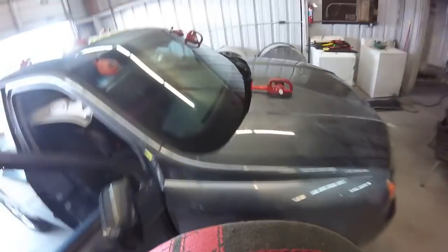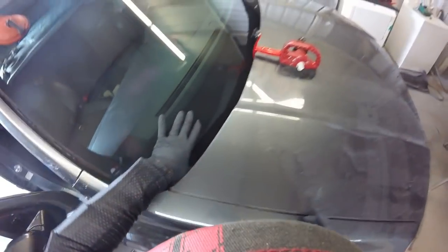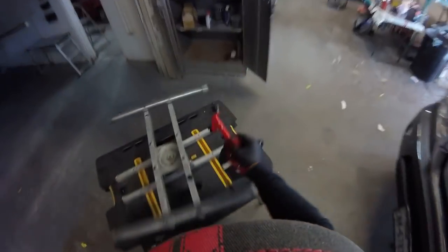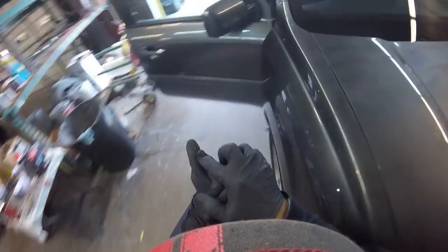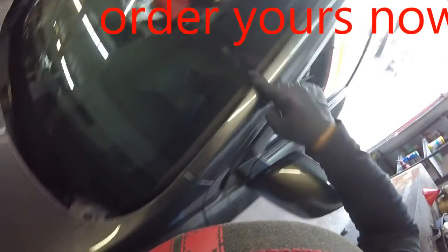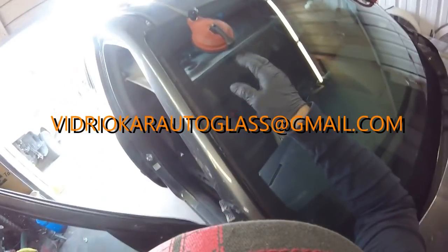Now for the last part, remember in this case your hand is going to be a little difficult on this point, but you can grab it from here. So up a little bit, and let it down. At this point, let me set my quick set over here. I got a spot but it's fine. I got a little spot right here because usually we grab the glass from here but I have to go a little more deep — that's why. In this case you can use a suction cup just to hold it up and down. The glass is set already. I gotta go just down here — quarter, quarter, quarter, quarter. They have to replace those clips. I suggest doing it before the windshield but they don't have it and they're in a hurry because it's Friday. You can see the quarter space for those clips.